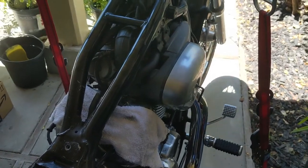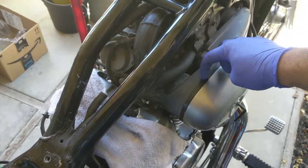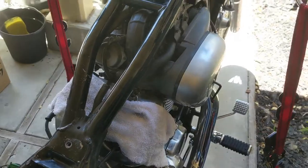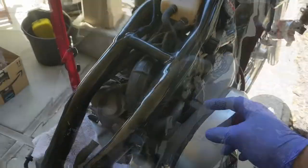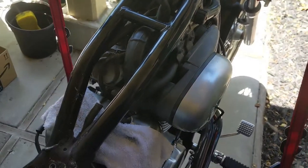After the fuel tank, I decided to remove the air filter — it's pretty bad anyway. It's the front piece, so it's gonna come with the cover, the filter — you can see the black part here — and then the holder, which I also removed. The idea is to remove part of the airbox which isn't necessarily needed.